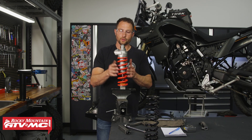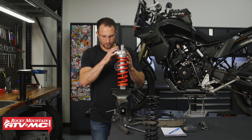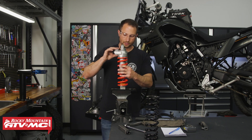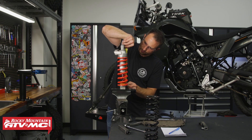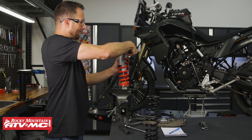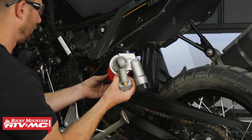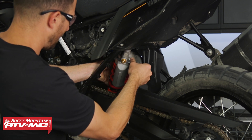Now that we have the spring compressors removed, you want to make sure that the eyelet is lined up with the clevis so when you go to install this everything is going to be ready to go. We have both mounting holes going in the same direction, and from here we need to set our preload. I'm going to take another measurement — I'm going to turn this adjuster in until I've got the spring compressed 10 millimeters. That's 219 millimeters right there, so we've got the correct preload. Now all we need to do is reinstall this onto the bike and double check the sag to make sure we're close to that 66 millimeter mark.